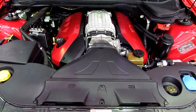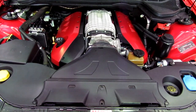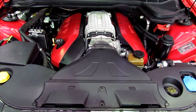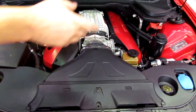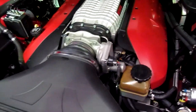It's more about when the fuel's hot — the viscosity of the fuel, and there are other factors involved — but we've really found that with all of these things, we need to step up a little bit bigger in the fuel system to make sure it can cope with hot fuel. So that's exactly what we've done: we've put a second pump in the system, run a second fuel line that comes around and goes into the other rail, so there's basically one pump for each rail on the engine.